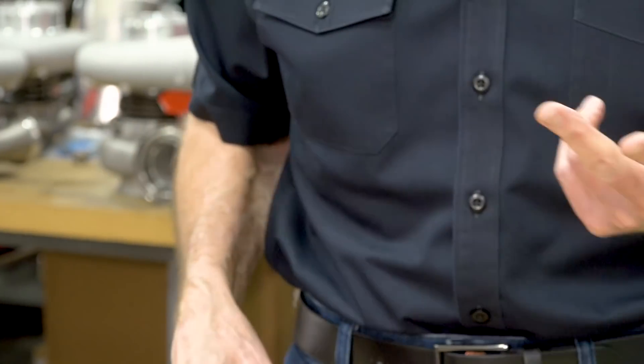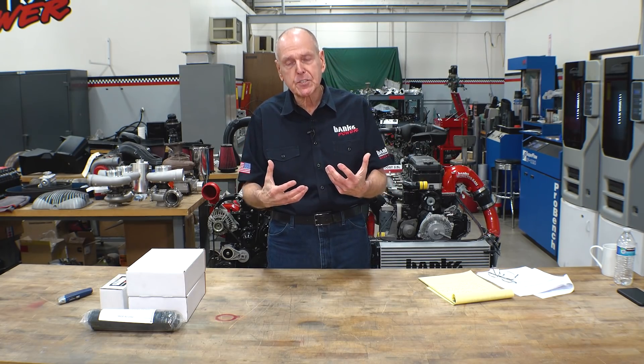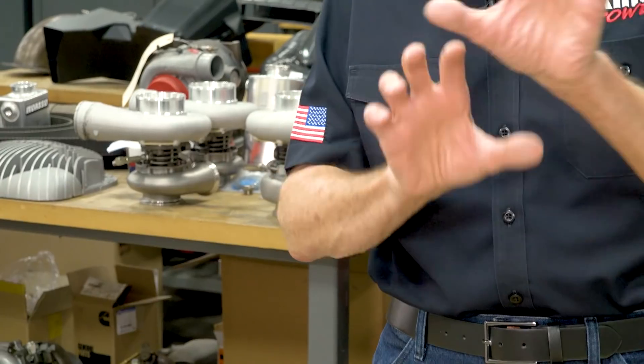I called my buddies at Holley and I said, I want to run gasoline in that cell and I want to run diesel in that cell. I need primary filtration, I need pump, I need return regulators, I need secondary filtration, etc. In the primary filtration I'm also going to do some water separating and other things, so that's going to be diesel-ish stuff. Then we get to Holley, and from there on we're Holley all the way to those Bosch pumps.